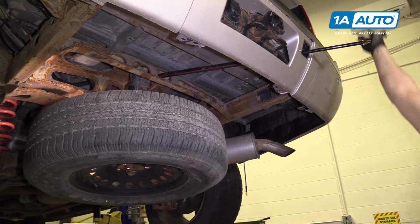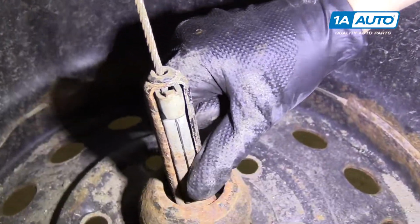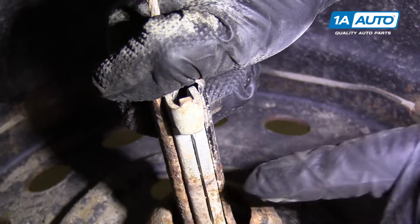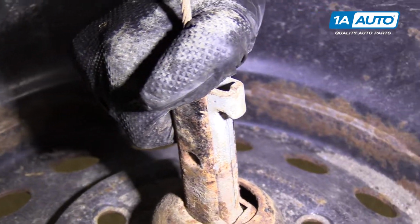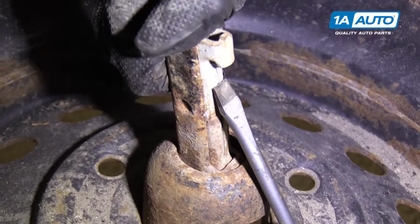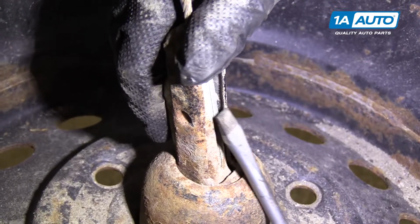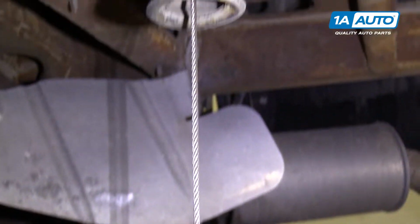so that's how we were able to get it to come down. So here's the lock mechanism that I was talking about. When this tire was stuck up there, this lock was stuck out. And all I did was take a screwdriver through the hole here and the hammer and push. And then that was able to release it, and then we were able to lower the tire.